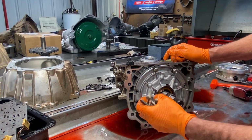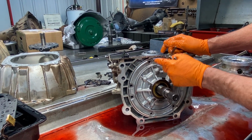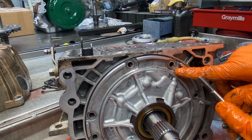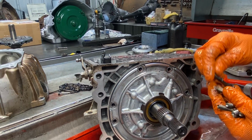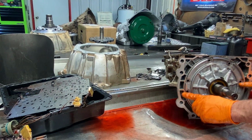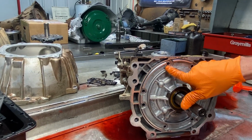No extra sealing on the bolts. You always want to do that, because see how much fluid's coming out of that bolt hole? So that one's full too. See, both these bolt holes are full of fluid. That's why you always want to double seal these bolts. You're not so much going to see it through here, but definitely you're going to see it here.